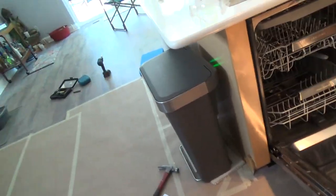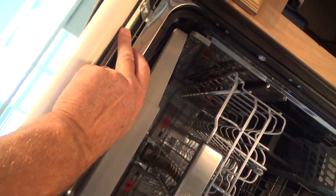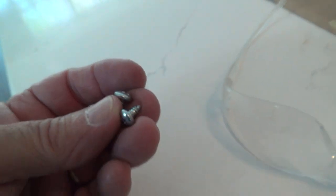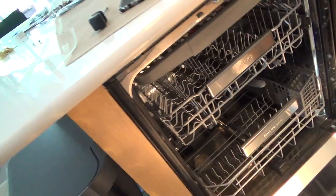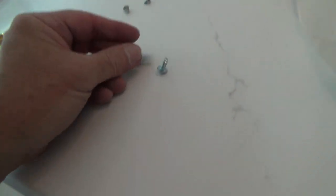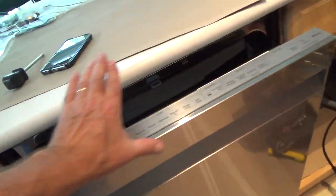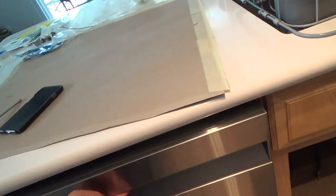I got it. I put the bracket up at an angle using the longer screws. I found a hole there and luckily the bracket was down just a little so I could screw it in further without hitting the counter. The little short screws just wouldn't work at that angle. I had the extra screws because I used the black screws elsewhere, so I used those and now it's nice and solid. You can't see the bracket because it's up there at an angle.